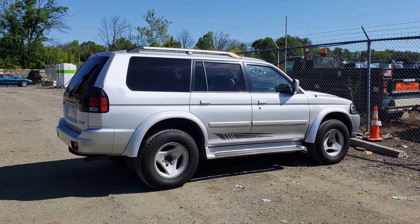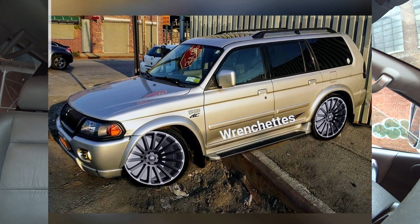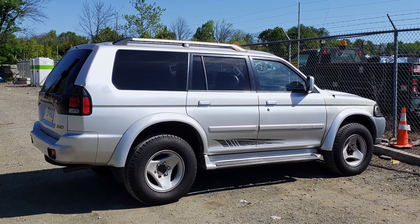And lastly, if you're wondering about the tires after one year of storage, you are right to worry — because these were dry rotted, horribly. Not extremely dangerous bad, but the car was wobbling all over the place. I thought it was the alignment, but it was actually the tire wobbling from dry rot. So I was looking for tires, and for some reason COVID affected the tire market as well. They were saying they don't have my tire size, 255/70R16, because of COVID — which is the most idiotic reasoning to blame COVID on.